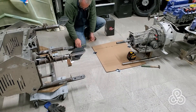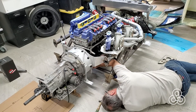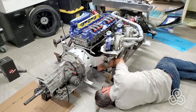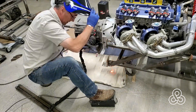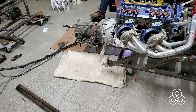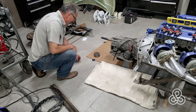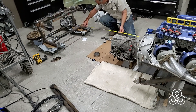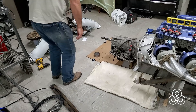I can put the laser on the center line and know where the center is on the subframe. The main brace for the coolant line is going to be bolted through a cross member I need to add — it runs just under the oil pan at the back of the engine. I'm going to weld that in place in a pretty contorted position, kneeling down and pushing the pedal at the same time, but we need a good solid tack weld. Then we're lining that front subframe up a little more permanently as we start welding — sandbagging it and putting heavy things against it to keep it from moving.